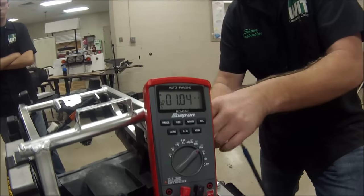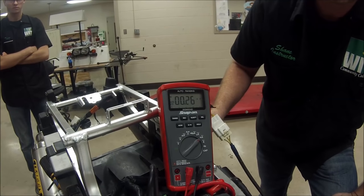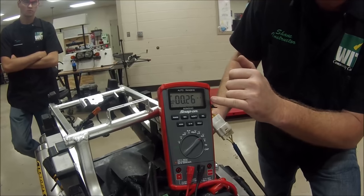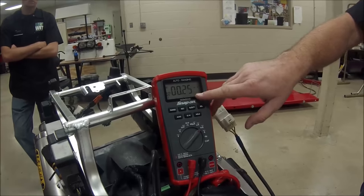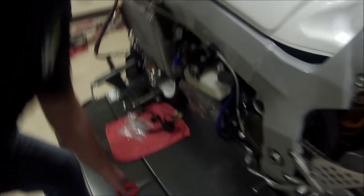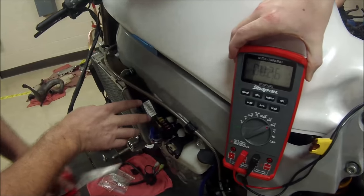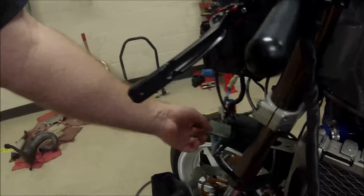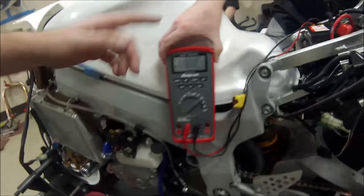When I disconnect the regulator/rectifier component, did our problem go away? Most of it — we still have the clock hooked up and some other things, but we got down to a much smaller number. We could now start disconnecting fuses one at a time. Looking at the fuses, here's an odometer fuse — as I pull that one, we went to zero. You can also just disconnect individual connectors until your problem goes away, and then you know exactly where it exists.